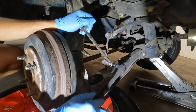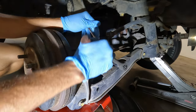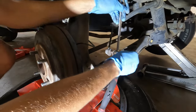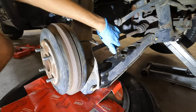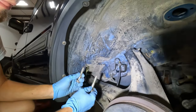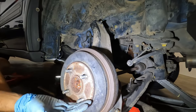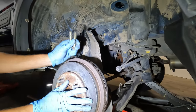Next, I'm going to be removing the sway bar end links. Since I'm going to be replacing them with coilovers they'll be different lengths, and I don't want any binding when I start doing the other side. Next, we're going to be putting the two trailing arm bushing bolts back into the frame. You might have to manipulate the trailing arm forward or back — in our case forward — to get the holes to line up, and possibly lift the trailing arm as much as possible since we're lowering the car.